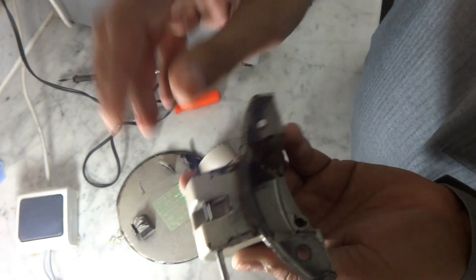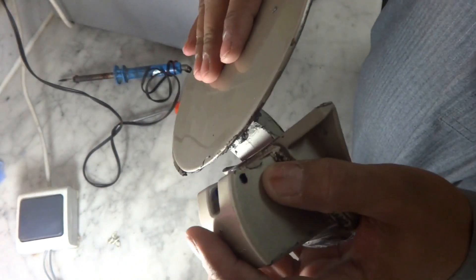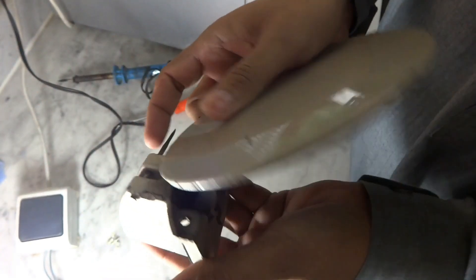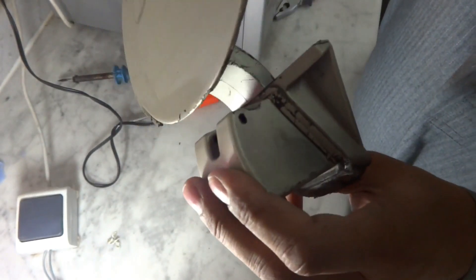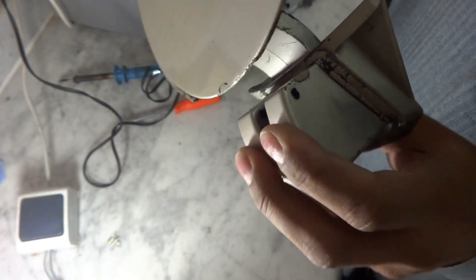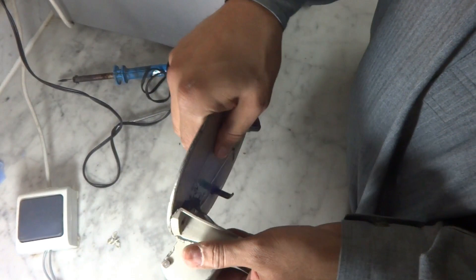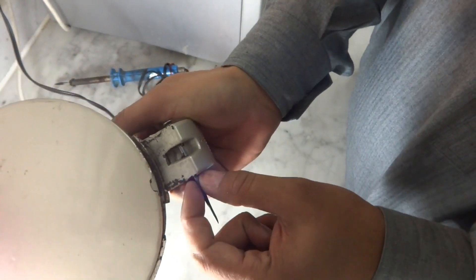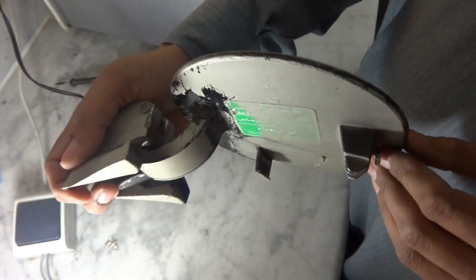So I will do a bending here, like this. What I have to do is remove it a little bit and we will do it using my pliers so that it will bend properly — on one side minimum, and the other side also the same way I have to bend it. And if it is possible, I have to hammer it a little bit but with care, so that the bend will be set and sit in properly. Now I have to take my screwdriver and we will make turns of this wire, and then at the end I will bend it inside like this.